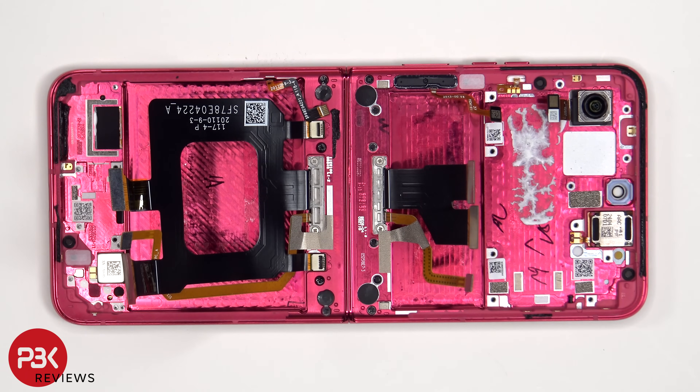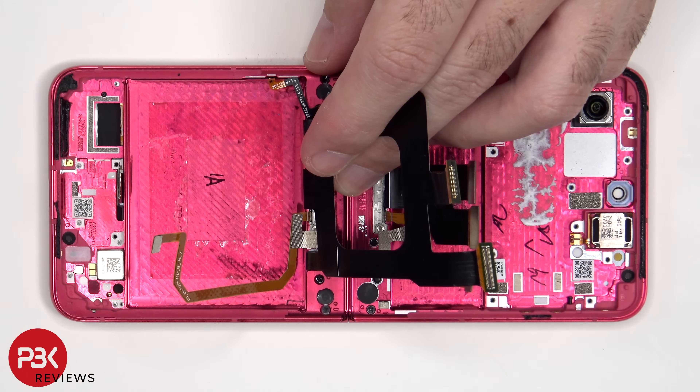If you need to replace the folding screen, once you have the flex cable disconnected and peeled off from the subboard, you would heat up the plastic border on the front and pry that border off, then apply heat to the folding screen to loosen up the adhesive underneath and pry it off from the frame. I'm not going to pry this folding screen off since there's a high chance of damaging it, and also if you don't use the correct adhesive to reapply the folding screen to the frame, when you fold and close the screen you can crack or damage it. I recommend going with a folding screen that comes with the frame pre-attached — it'll make your job a lot easier.